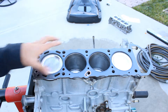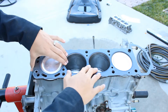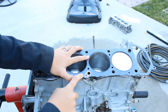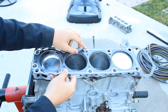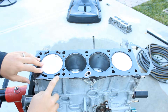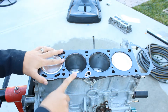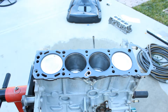Hello and welcome to DNA's Garage. Today we're going to be installing the head gasket. You want to have this aligned as best as possible, but don't worry because when you put the head it's going to move. I use this dowel pin — I'm not sure that's what it's called — on this side it doesn't fit, but if you flip it, it does fit. That's a clear indicator that it's incorrect. Also, this oil port right here surrounded by copper — those are two things that can tell you that you have your head gasket wrong.